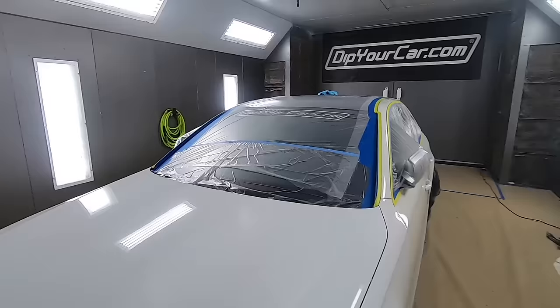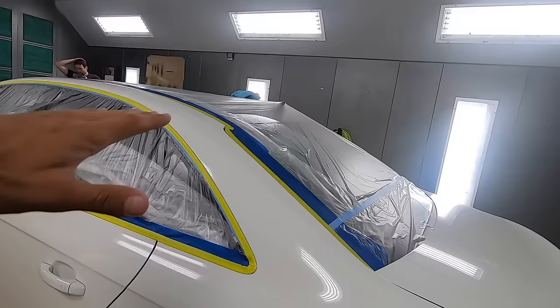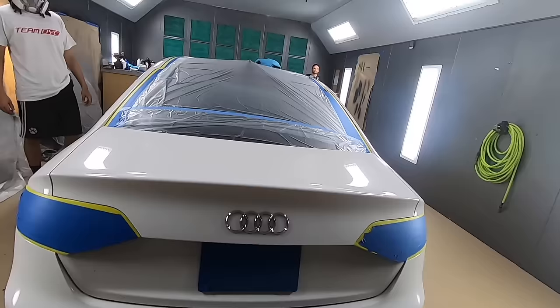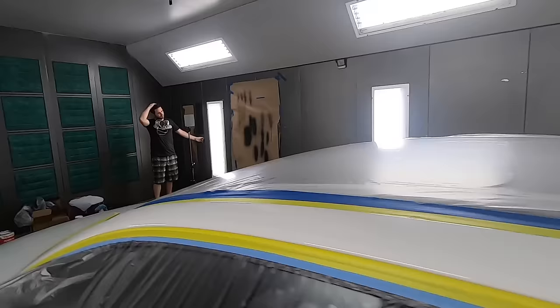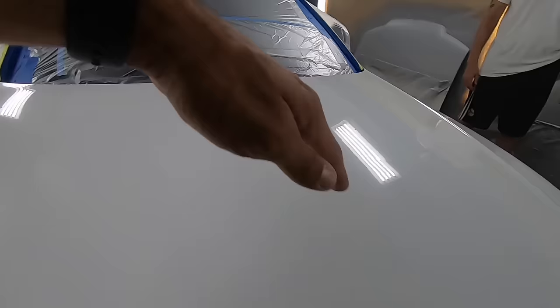So I like to try to focus on like this right here and knock this pillar out and then walk the length of the car back and forth from the top down until that side of the car is done. Then move over to the back, start on the trunk lid, go back and forth, top to bottom until that's coated. Then we'll probably need to refill the gun, work our way over here, work on the hood of the car. You're gonna go this way. And then once you can't reach anymore, pass over here, connect it, spray the front bumper area, and then repeat down the side.